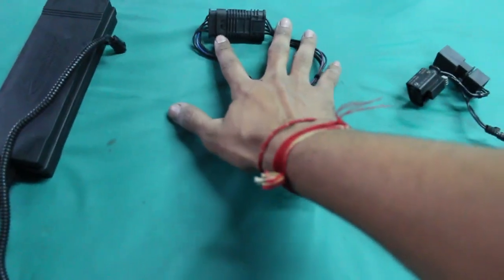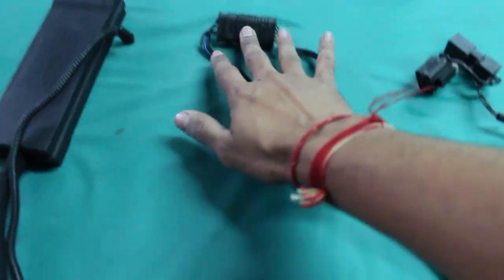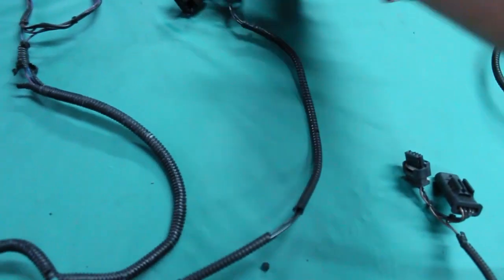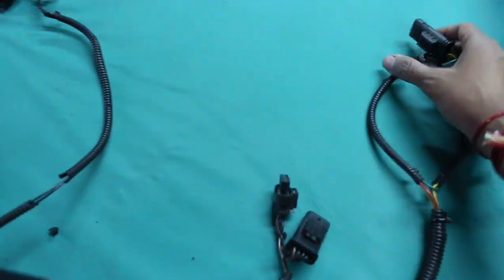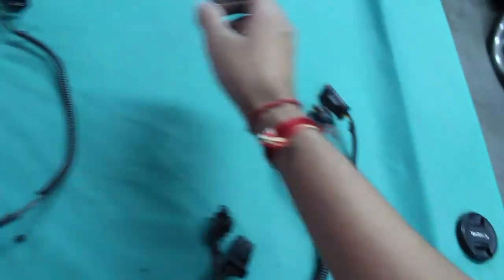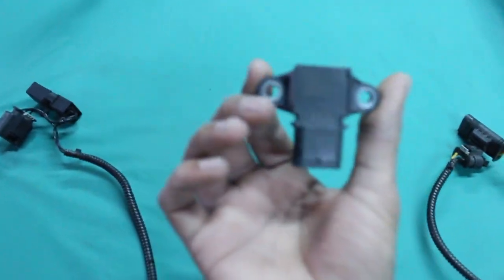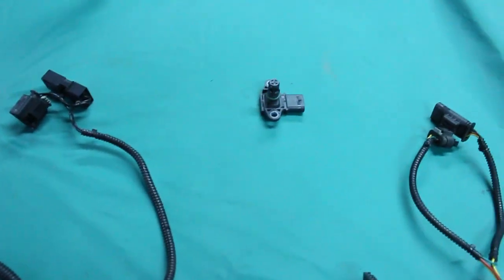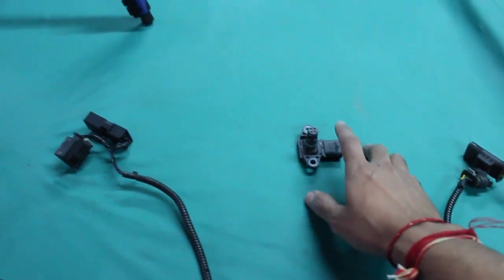Now this wire is a blank — it can be used with PWG models. If you have a pneumatic wastegate, you connect this into that specific socket and that will work from there. Then you have these 3 other connectors: this one connects up to your car's fuel rail, this one connects to your MAF or mass airflow sensor, and this one connects to your T-MAP sensor found on your charge pipe. For an additional upgrade, you can get the BMW 3.5 bar T-MAP sensor, which allows you to run a higher boost level so you do not have any drivetrain errors.